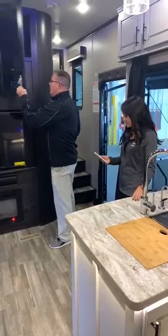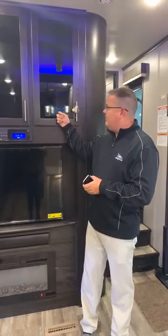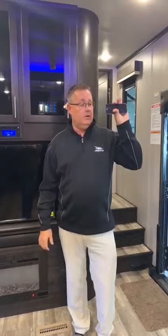Another neat feature that people are starting to find out about since these hit dealer lots in early August is TPMS — Tire Pressure Monitor System. It's standard on every one of our luxury coaches: North Point, Pinnacle, Seismic. When you take possession of your new Seismic during the pre-delivery inspection, we send the TPMS monitors in the owner's packet. The dealer screws them right onto your valve stem. We do all the Bluetooth pairing here at the factory. As you're going down the road, it updates every 10 minutes. If you have an event — pressure going down or temperature exceeding the pre-programmed PSI or heat range — it will send an alert directly to your phone.